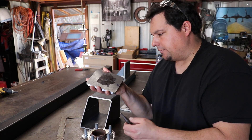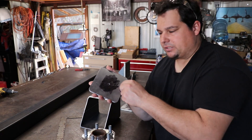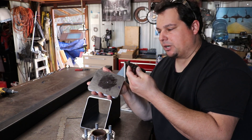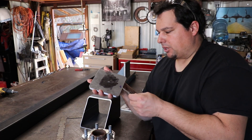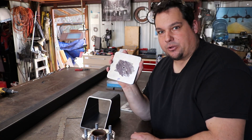The way I figured this out is I used my calipers and found center. Then I used this spring-loaded center punch, which is really neat — you push it in and it pops, and it puts a little indent in there for you. Pretty cool tool. Anyway, I'm going to go machine this up.